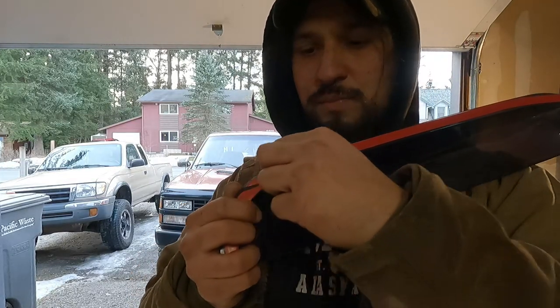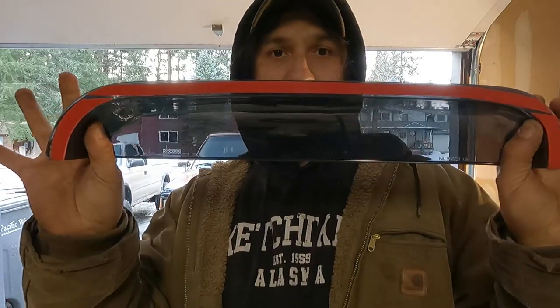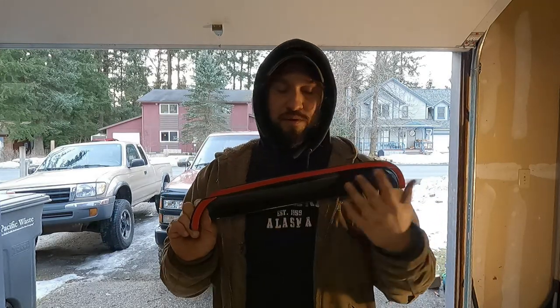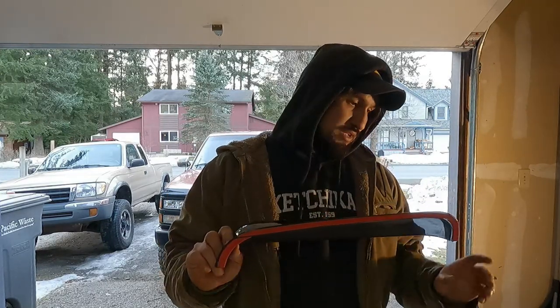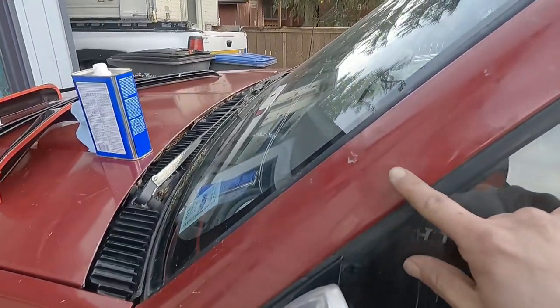Also, a handy tip is to just peel this back a few inches on each side. Get it lined up where you want it. If you get your orientation wrong and you need to pop it back off, you can do that without destroying all your adhesion. But don't do that too many times, because you'll ruin your adhesive, and then all the other prep work doesn't matter at that point. Once this is ruined, it's ruined. So take your time, get it right the first time, and then you don't have to worry about it after that. This is why acetone is going to be so important.